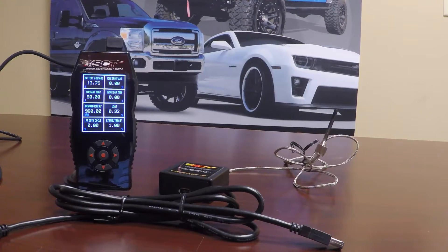Hello everyone. This video is going to demonstrate how to set up an analog input for your X4 using a firewire analog cable. The first thing you will need to do is make sure your device is up to date — we do cover that in another video. You will also need your X4 with OBD2 cable, your firewire cable, and your analog device. In this example, we are going to be using an SCT EGT Pro.